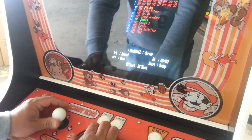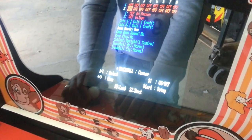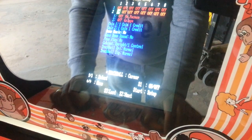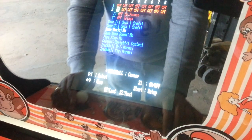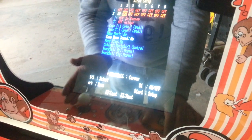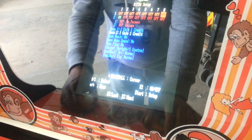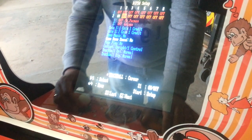Now if you want to do some adjustments for the machine itself — coin one credit one, coin two credit two, credit one. We want to turn off the demo music because it's pretty annoying. Game demo sound can be on or off. If you press down it goes to the games, but you want to adjust the dips so you press to the right and back, and here again up to the dip settings on dip one. Press down and left and right and you can change controls and free play on or off.